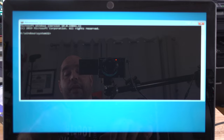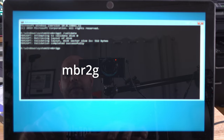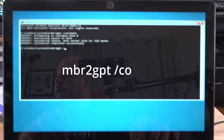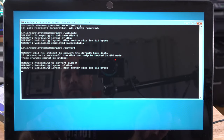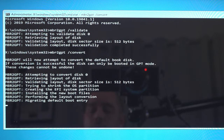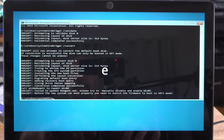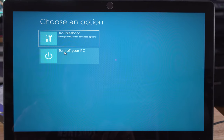Here we're going to be converting your MBR partition to GPT. During a conversion or migration, there's always a chance of data loss. You're watching me do this live and it worked perfectly, and chances are it will for you too, but that possibility always exists, so be careful. Type: MBR2GPT /validate, then MBR2GPT /convert. This takes a few seconds. If it says error output, that's normal. Then type exit and select Turn Off Your PC.